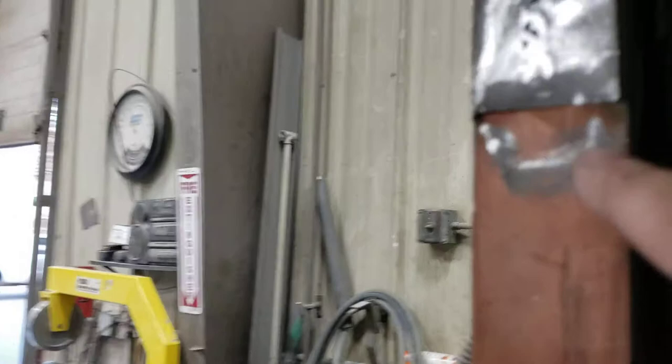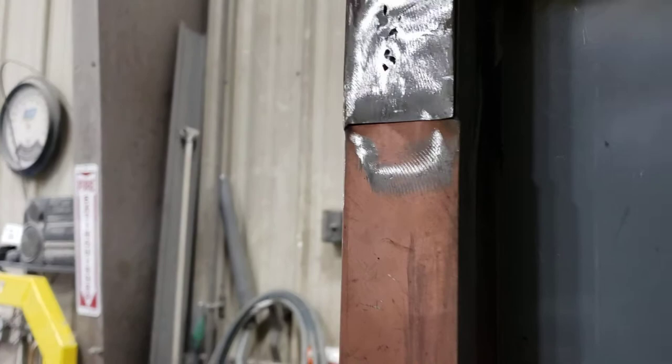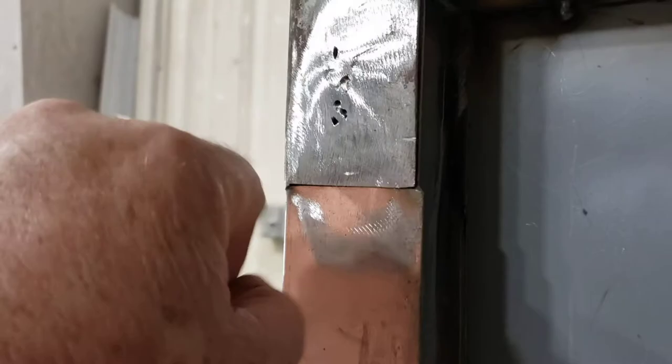To give it a little bit more rigidity, we came up here and welded a piece of one-by-one square tubing the whole width of the vehicle. We'll pop this off real quick, run a stitch around, and grind it down clean. We still have to grind both sides up here, stitch that shut so it's nice and smooth, rind it, and fill a couple of pinholes up here. We've got all the inner bracing added to stiffen the side panels up.